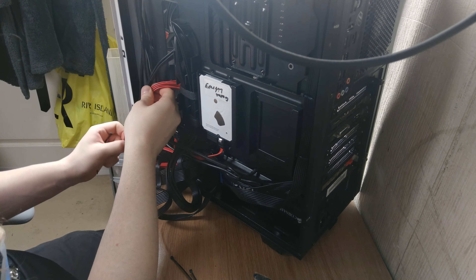A little trick for PCIe cables: when they come apart, you generally have the main cable going to your first connector and then it spreads out to the other one. What I like to do is fold it back in on itself and zip tie it tight so they stay a lot closer together — which means when you need to plug in this big cable they're close together and easy to plug in. Also, if you only need a six-pin and an eight-pin, fold back the extra two-pin and use the same zip tie to keep it neat. It'll look a lot nicer and this is a great trick if you don't want to pay for custom cables.